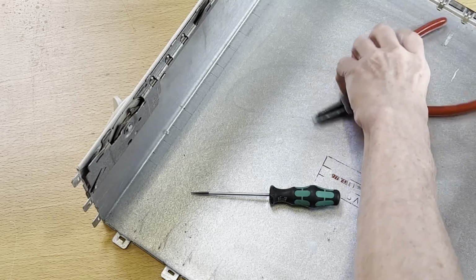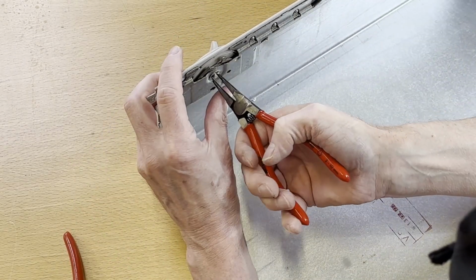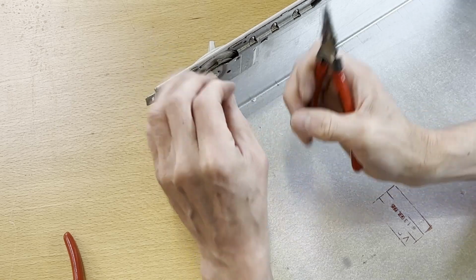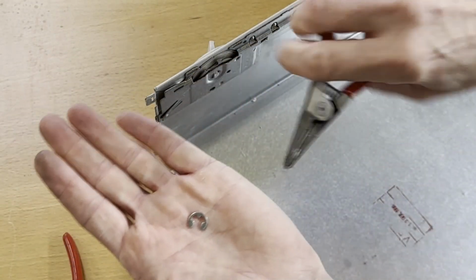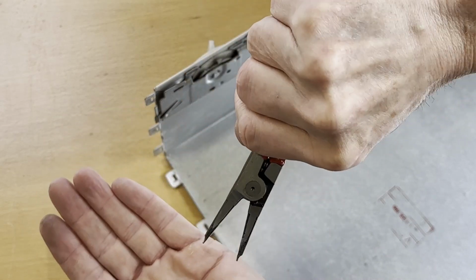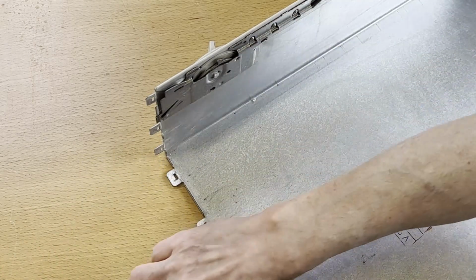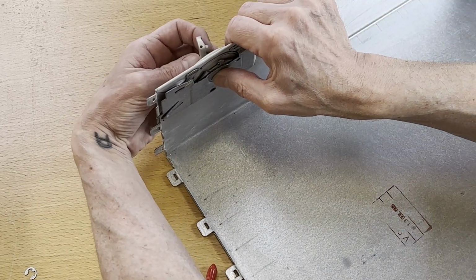I know you can't see it. But let me just take it out and we can have a look at it. Again, being very careful. There we go. I don't know if it's in, you can push in here and then widen. Don't press like crazy, just a tiny bit out and then you can move it up. Let's see if this gives us access to the button. It does. I can take the button out.